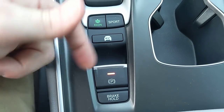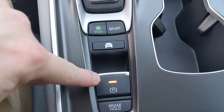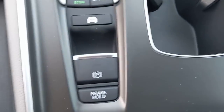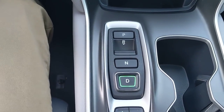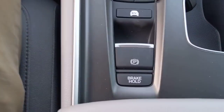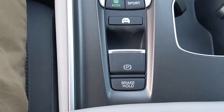The parking brake is electronic — put your foot on the brake and lift up on the trigger to set it; you'll see the red LED come on and 'brake' appears on the display. To release, foot on the brake and press down on the trigger. Below that is brake hold, which requires your seatbelt to be on. With brake hold active and the car in drive, come to a complete stop and release your foot off the brake — the car holds the brake and you don't move. It's a convenience feature for stop-and-go traffic so you're not constantly pressing and releasing the brake.